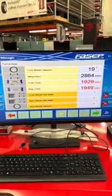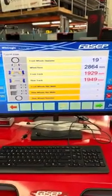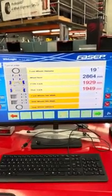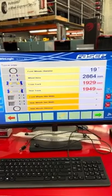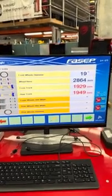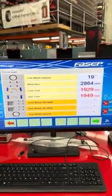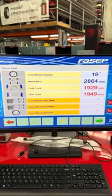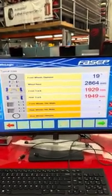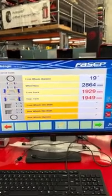So in the previous system, we used the track measurement gauge on a car like a BMW that has different size wheels front to rear. We're only going on the inside track, so it doesn't understand that the rear wheel is a wider rim than the front rim. So typically we would have had this 20mm difference, but it would have said that the front track is 20mm difference rather than the rear track. To correct this, you type in the front wheel width, rim width, and the rear wheel's rim width, and this will offset and correct the track for you to give a good alignment.